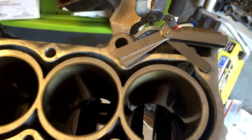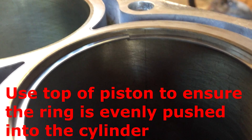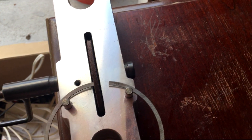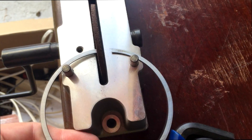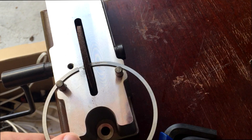I'm going to stick that in the block. The 87s are way too big, but that's what the ring gap filer is for. Obviously I can't put a feeler gauge in there yet. This is the one I use for the top ring. I got my drill and everything hooked up. You've got to use this tool so that you can make sure you line it up perfectly so your end gaps don't end up diagonal. You also only want to file on one side — I'm going to be filing on this side — and you want to file towards the inside of the piston. You don't want to file towards the outside; it might mess up the coating on the outer side of it.